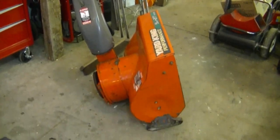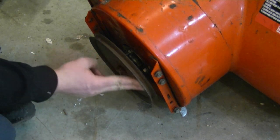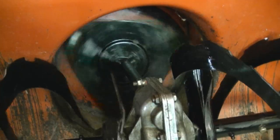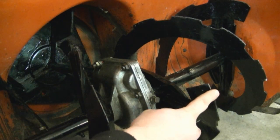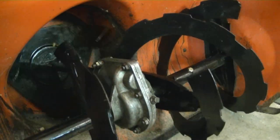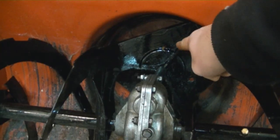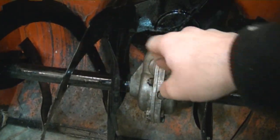I've got the front end of a snowblower here to show a quick demonstration. This pulley here is attached to the impeller — as you can see there are a lot of rotations. Notice how slow the augers turn compared to the impeller. I counted and the impeller turns 12 times for each one full rotation of the augers.